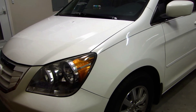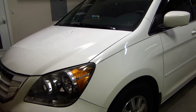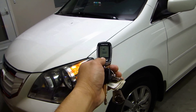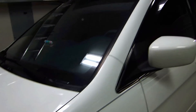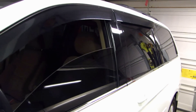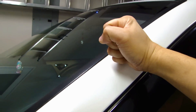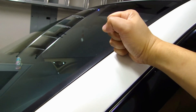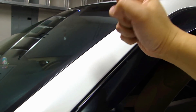Make sure you set the shock sensor properly. If you have it too sensitive, the alarm will go off all the time and you'll be upsetting your neighbors with false alarms. Arm the vehicle and give it about five seconds for the system to initialize. Then go to all four corners of the vehicle — on a van, you have the A-pillar and D-pillar at the back. Make a fist and give a firm tap on the A-pillar. If it goes off by simply touching it, it's too sensitive and you need to turn down the sensitivity.